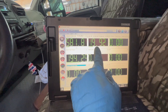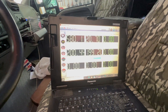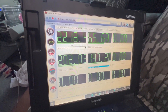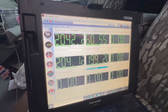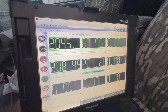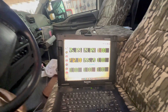You ought to be able to get the IPR to go above 70 percent no matter what, and even driving it yesterday when I drove it hard I could not get it above 70. So it should be doing all it will do to try to keep it running. It may not die sitting here not being under a load — there it is. I don't like his oil temp sitting here at idle.